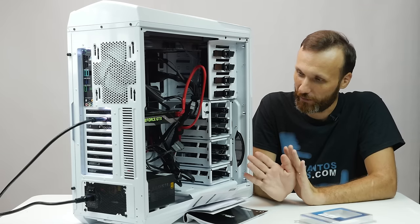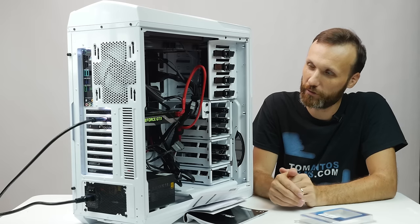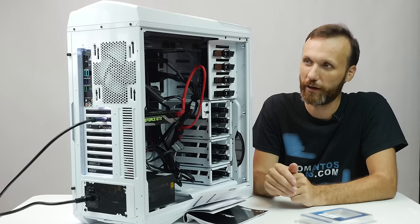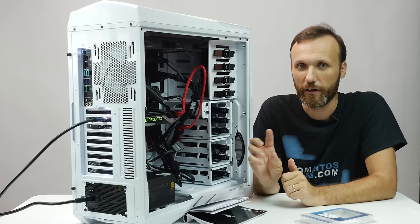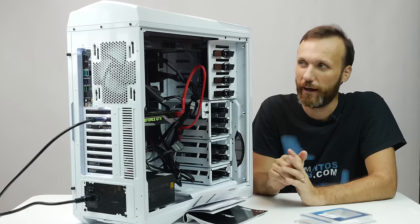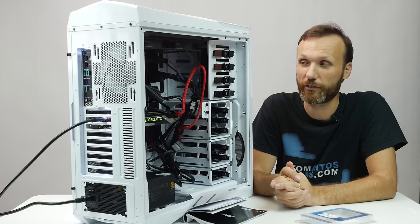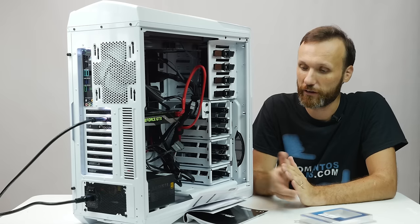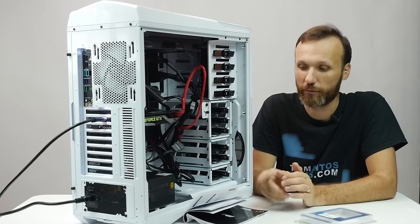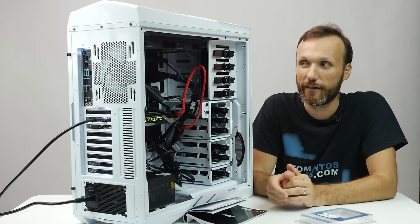Here, I can say I've checked all the wires, everything's okay, and I can see the motherboard start up and display that error. I've tried taking out the memory, because if it shows you a memory error, it could simply be that the memory bar isn't properly inserted or things like that. But I've taken it out, put it back in, all that stuff. It just doesn't make a difference. After also having contacted ASUS, they pretty much told me that my best bet is to get one of the memories that they have listed in the manual. So that kind of sucks.